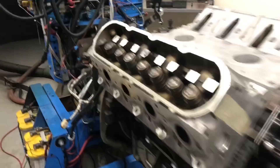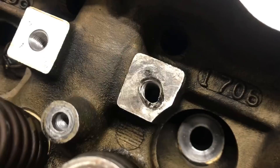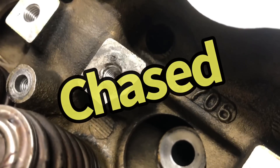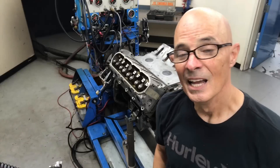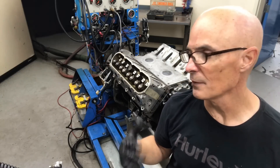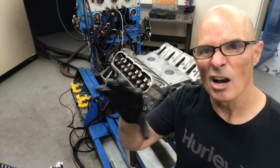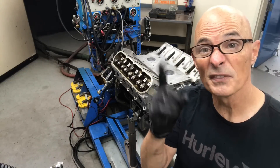So we're taking a look at problem number one. You can see the guy tried to drill out the broken stud, or broken bolt. We've since tapped it and we're going to try to run it - see what happens. I'm going to pull the heads off; they've already been off because I tried to clean the ports before, but I'm going to show you what I'm talking about. One of the ports, the one that has the broken deal on it, it's all clogged up, and I think the cylinder is worn, so we'll take a look and see what we've got to do to fix it.